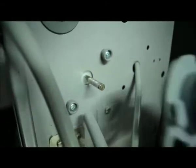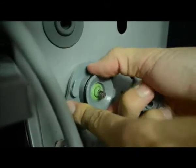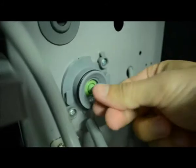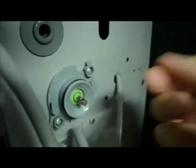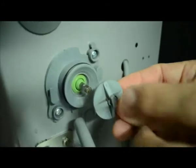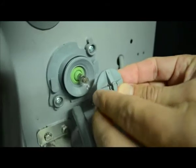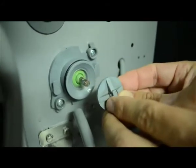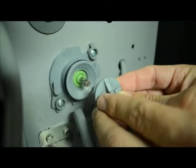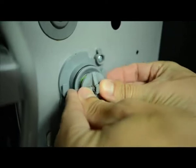When putting your whipper blade back on, the first piece to go back on is your backing plate — just sits on and clicks into place. On the little steel pin there's a flat spot on top, and on your whipper blade there's a little dot that sits on one of the four pieces. That dot lines up with the flat spot. All customers have been shown this at installation — simply line it up, push it straight on, and you're done.